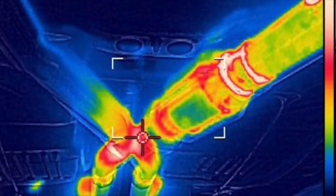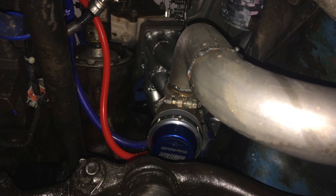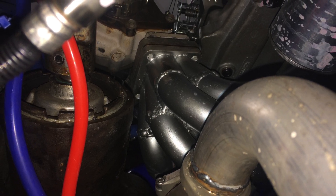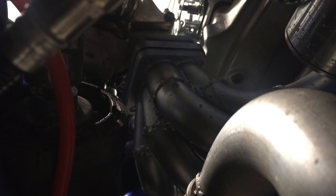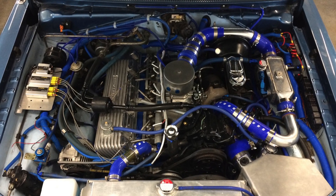Here's some thermal camera work seeing how well that blended as it went back to its crossover pipe, confirming our results. The wastegate is mounted probably in the worst possible place, but because it is the size of the stock exhaust for a slant six, it actually controls the turbo just fine. Thanks for watching.